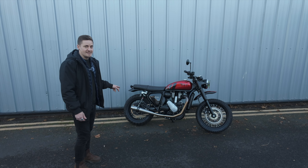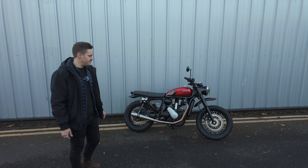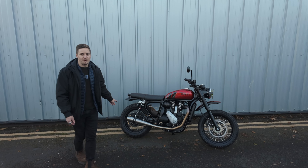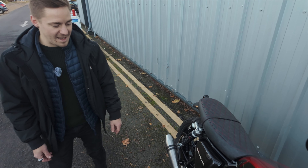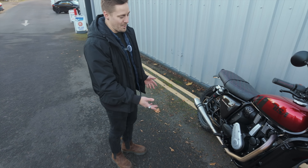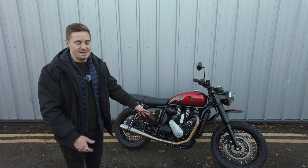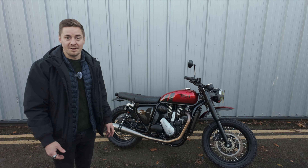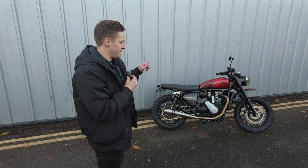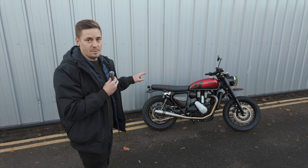Full stainless exhaust system — it's actually a system made by a manufacturer people will probably be familiar with. We've made a few changes to create a slightly upgraded version. We drilled through the baffles so it has a baffle but it's slightly louder with better flow. We're currently developing a new system that will have a shorter muffler, which a lot of people are looking for. Full chain and sprocket kit — two extra teeth on the rear sprocket so it's a little bit more lively, more wheelie-happy as a scrambler. Another part people are very excited about is the cat delete kit — behind the exhaust system, when you remove the catalytic converter, which is very heavy and large, there's a huge hole under the engine. Guys developed a kit that blanks that off and it's now available to buy — you can bolt it straight onto your Gold Star if you've already done an exhaust change.